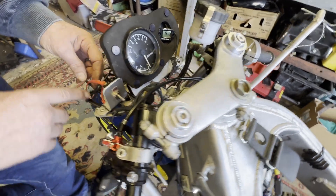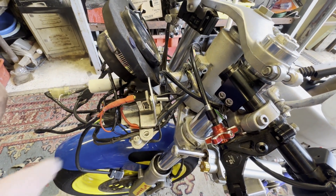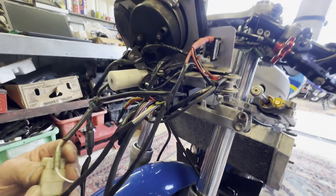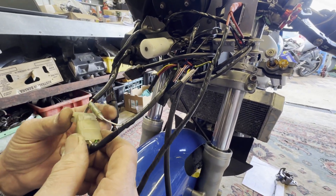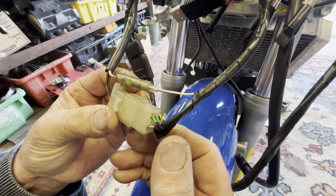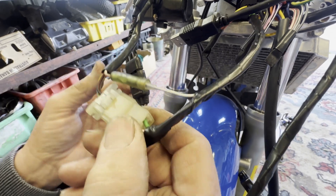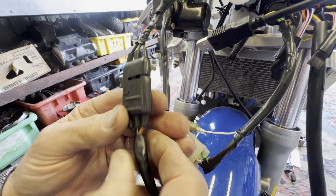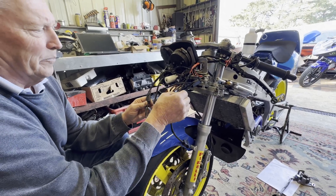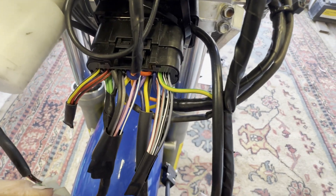From there we've taken power to the various things we need to run, like the tacho. The unit didn't come with any connectors on it and we weren't keen on removing our genuine Yamaha connectors - we wanted to keep the original parts so they connected correctly. So we went ahead and made new plugs onto the Ignitech wiring for the power valve setup and the tacho plugs - they're original Yamaha plugs and we were keen to stay that way; it makes it a bit neater and easier.